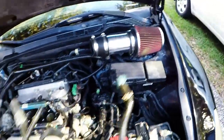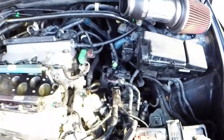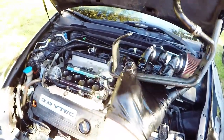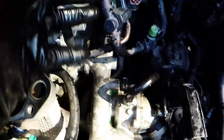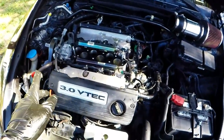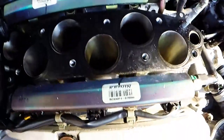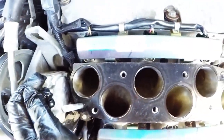Since this customer has a short ram intake, he already bypassed the stock induction tube assembly. On the 03 to 05 seventh-gen, there's a small green cap valve — that port goes into the intake manifold, just unclip it and you can clean up the engine bay. Now we're going to pull the intake manifold off completely, and check out these Halfland Performance runners — look at that gasket matching, that is exactly what gasket matching should look like.